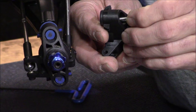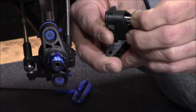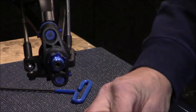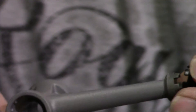If your pivot ball is too tight, you won't get the full range of movement. If it's too loose, you get the full range of movement but you have play in it. What we're trying to eliminate is that play while still having the full range of movement. To do that, you adjust it with your pivot ball cap — and if you've never used this tool before, that's what the end of it is for.